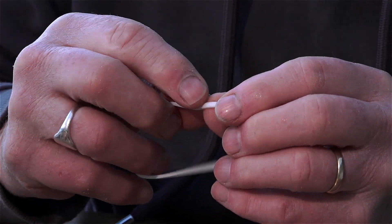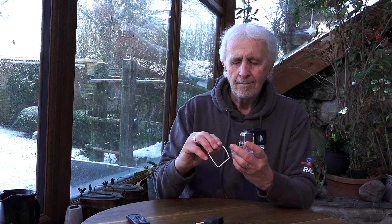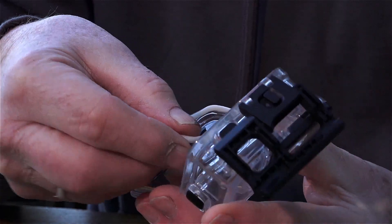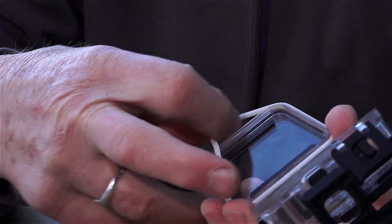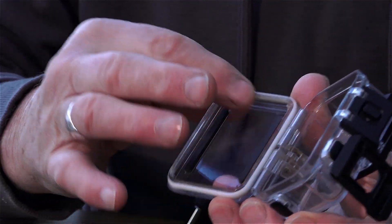That would again make the o-ring defective and let water in. To put it back, also make sure where your o-ring is seated is free of any dust or sand. With GoPro o-rings, one end or side is slightly larger than the other, so make sure you put it in the right way — the flatter, bigger side fits in first. Fit it around, and make sure it's not twisted. As these are slightly square in cross-section, you need to make sure there are no twists in it at all. Give it one extra little check.